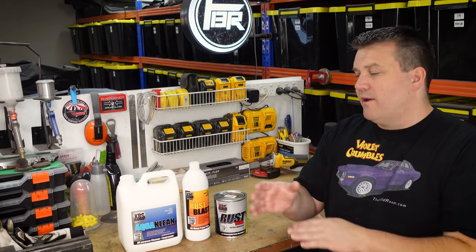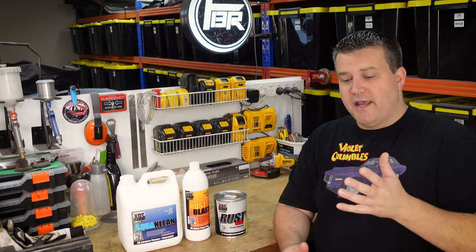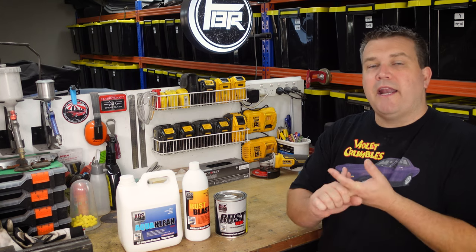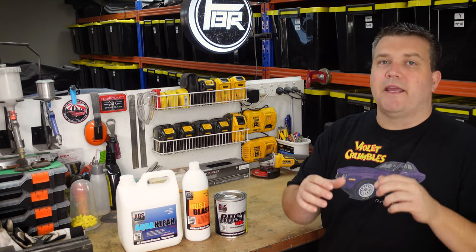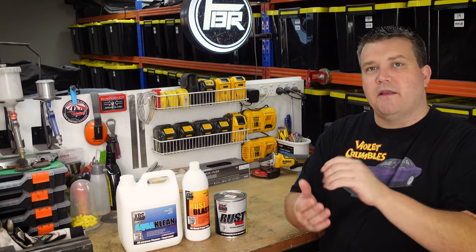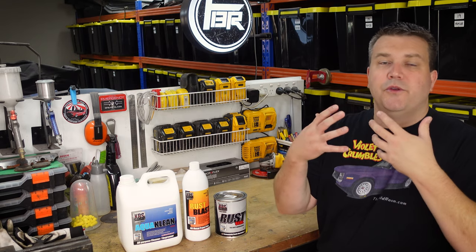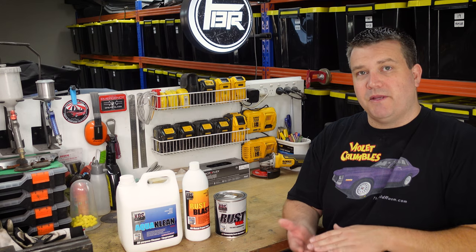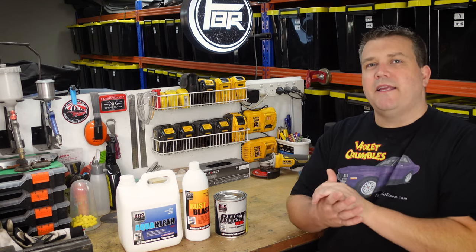Now, I know when we're talking about products like this, a lot of people would suggest that Raptor Liner is the way to go, because it's pretty big on the scene at the moment and has very heavy advertising. I don't have any problem with Raptor Liner itself, but for the interior, it's going to make it really difficult to stick on any bitumen underlay or anything that I want for sound deadening or to control temperature. That's going to have trouble sticking to the Raptor Liner surface because it's not smooth. The second thing is that Raptor Liner also can't adhere to bare metal.